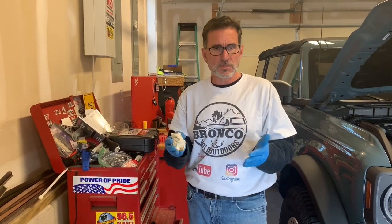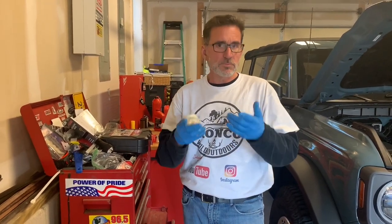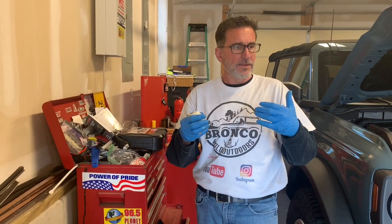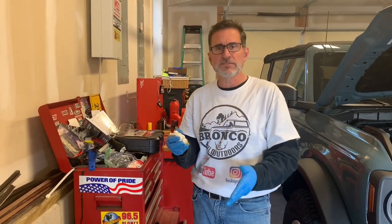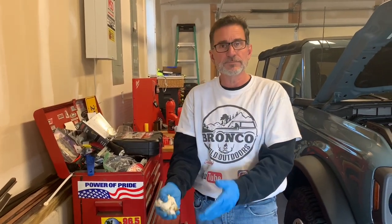I'm going to start at 6 quarts, prime the engine, which I'll show you how to do, and then we'll remeasure, and I'll most certainly be putting in that seventh quart because, hey, that's what I took out.